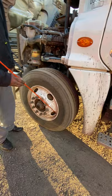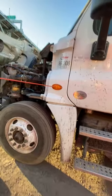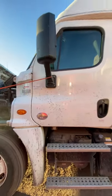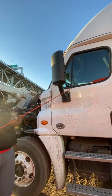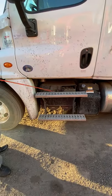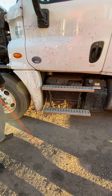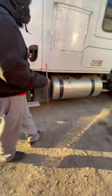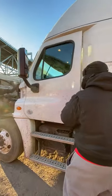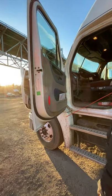This light here is our left turn signal, four-way flasher, and marker light. It's amber in color, not broken, cracked, or damaged, and the glass is clean and clear. Our steps leading up to our cab are properly mounted secure, free of any debris — there's nothing on there that's going to cause slipping going into or out of the cab. My door is properly functioning — it opens, it closes. I've got the weatherstrip around the door with no ABCDLs.